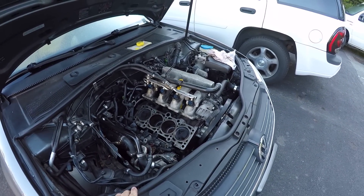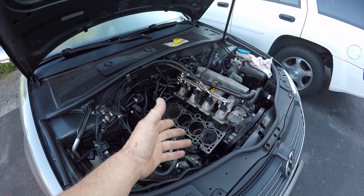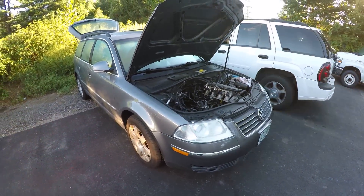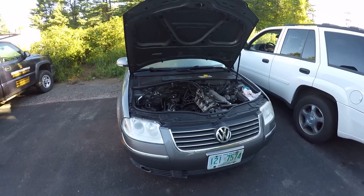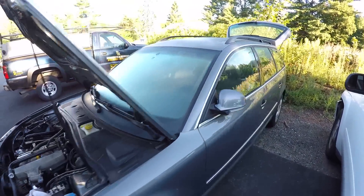So we sent the head back and they checked it more carefully and found a crack in cylinder number two exhaust, right where I kind of predicted it was. We saw the evidence of coolant leaking there. It took a little while to get another head. We got the head inside — we'll take a look at it in a bit once we push this thing in.